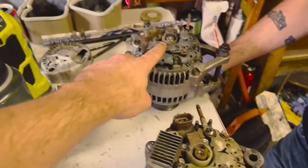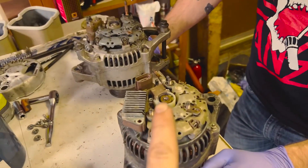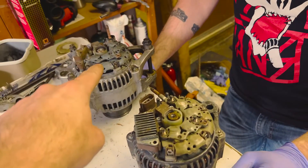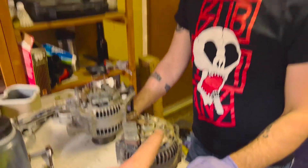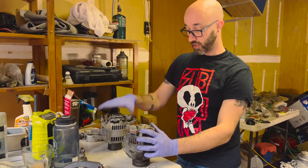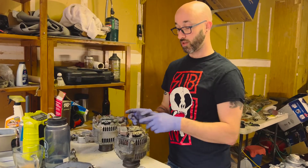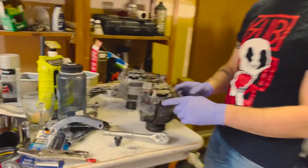What we're doing now is taking the Toyota alternator and the Dodge alternator side by side — they appear to be relatively similar. Our electrical engineer is helping out. What we're doing is swapping the voltage regulator from the Toyota into the Dodge, because we're going to use the Dodge for the Cummins swap. The Dodge unit is externally regulated whereas the Toyota is internally regulated, and unless you want to change all the wiring harnesses on the cruiser, you can just swap it.